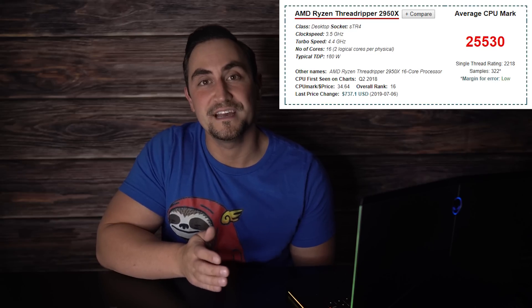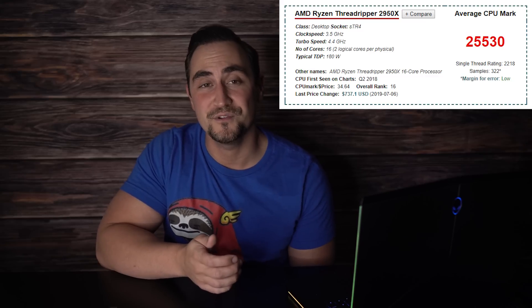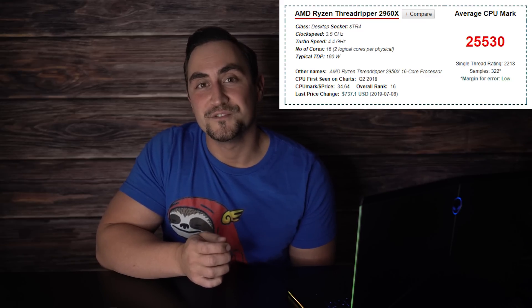I fully expect this could change at some point in the future, but as of today, what that means for anyone leveraging hardware transcoding with their Plex media server is: if we pair a P2000 with the wrong CPU — say a Threadripper 2950X with its 16 cores and 25,000 PassMark score — we will ultimately end up with CPU resources that are left untapped. This obviously assumes you are using your Plex server for nothing else but Plex. If you run virtual machines or other jobs on your Plex server, the CPU will get utilized, and adding a P2000 is a great way to free up resources for other tasks — which is exactly why I have dual E5-2690v2s in my server.